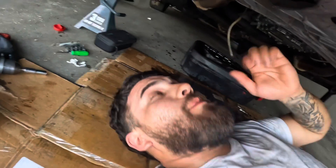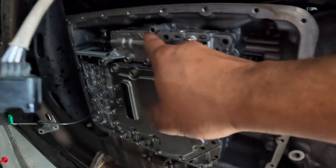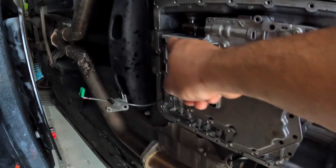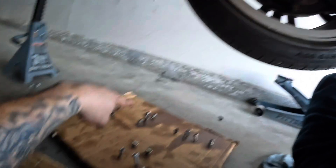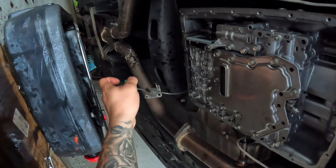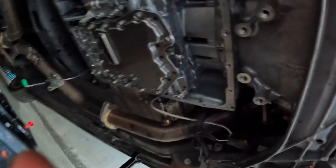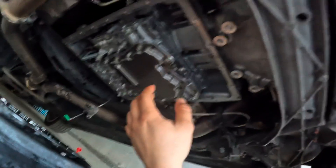I did not record when I put it back on, but it's the same thing putting it back on. I only put one screw in right now — it's holding by one screw. You just plug in that green connection on top again the same way you unplugged it, and plug back in down on this side. Put all the bolts back in — I have them in order. You could use a marker to mark them. Then put it back on, clean the transmission oil pan, and put it back on. I have a gasket so I'm gonna put the gasket on and put the oil pan on top — from there you should be good.